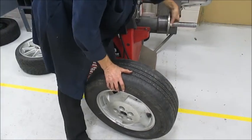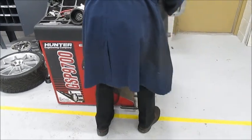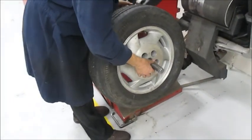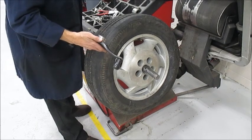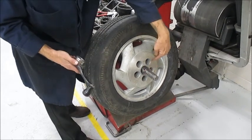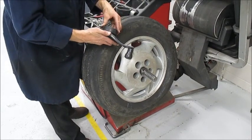I'm going to put the wheel on — there's nothing on the arbor right now. I'm going to slide the cone in, obviously pointing in, change it up on the wing nut, and take the big cup off. I'm not pushing the wheel against the cone; I'm trying to push the cone into the wheel. Big difference.